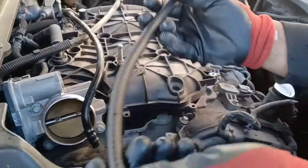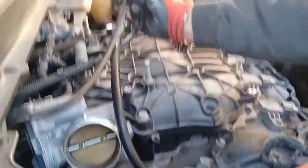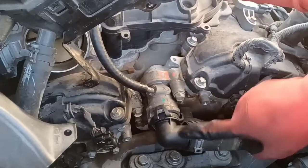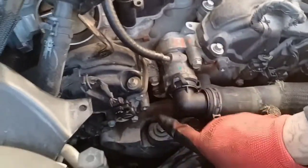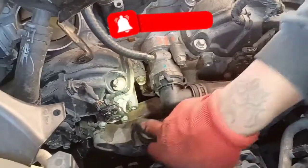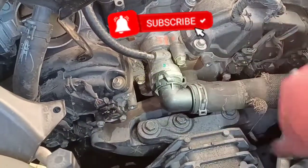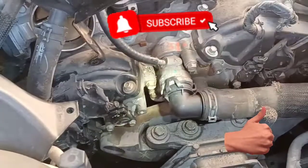We'll have to make it work — get this hose to connect with the other hose over there and put a clamp on it. Always check on this water neck because it's made out of plastic — it gets hot, gets brittle, breaks, the seal starts leaking. You can tell because you'll start seeing brown spots, like water stains. That's how you know it's leaking. If this video helped, like, comment, subscribe, and we'll see you on the next one.